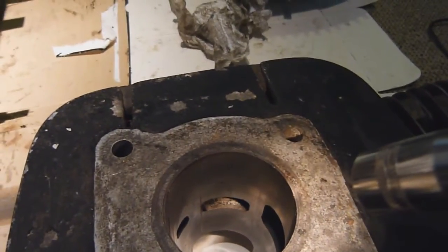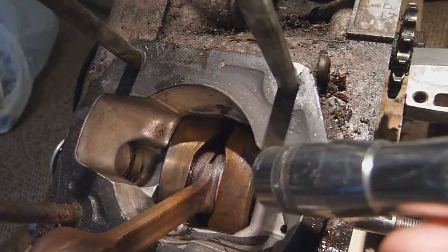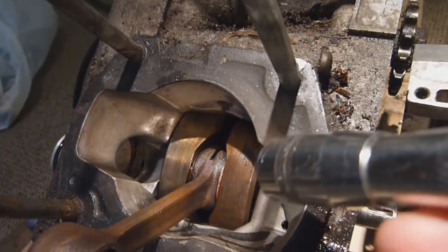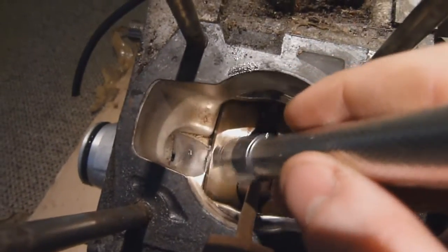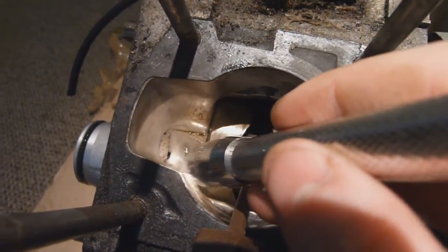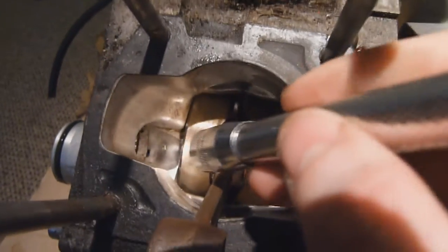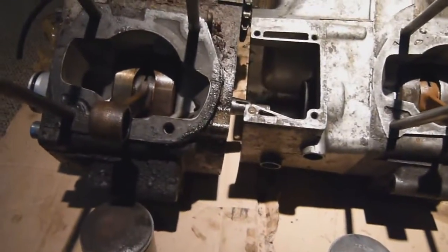Other things that can happen: fragments can get into your disc valve and grind that up. There's a slight gap where fragments can travel — this little slope collects them and feeds them down into the disc valve, wearing it down. To be honest, by the time it's got to that point this engine should not even be running for that to happen.